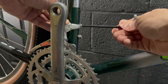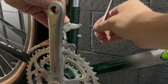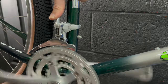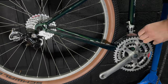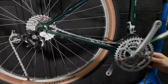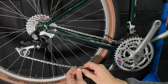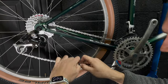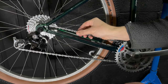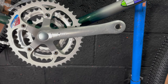One thing I found kind of annoying is there's a spacer to lift the front mech away from the seat tube bottle cage boss, but that's missing - I'll put a blank allen key in there to sort it out for now. Onto the chain, I'm fitting a SRAM 7-8 speed chain, a basic PC850 or similar, with a quick link. This chain I've been playing around with hot immersion wax treating, so it's super clean and should run clean for a long time, especially given the medium to little use this bike will get.